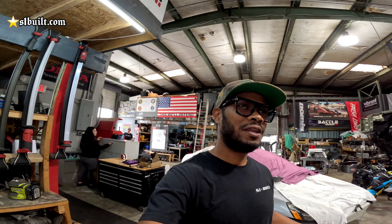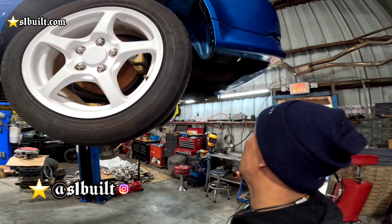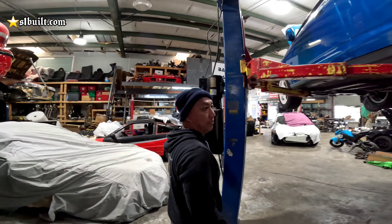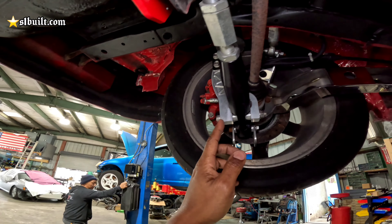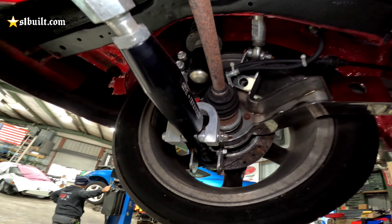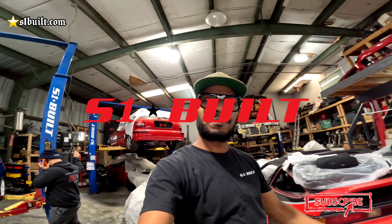If you want to use an offset lower control arm you can get away with it, but we do highly recommend our billet forks — that's why we made them and that's why we have them on all our cars. This is an RSX that we're getting done with our new billet diff mount, coming soon. Once more, back here — this is a CRV diff, and as you can tell the axle is straight. If you put an offset lower control arm in here it will mess up all the geometry and cause a bind eventually. We highly recommend our billet forks, which provide more clearance and also help if you plan on running a beefier CV joint in the back. Like and subscribe — we thank you guys for all the support, 2024 good luck.